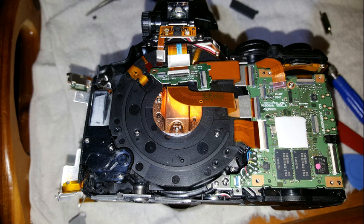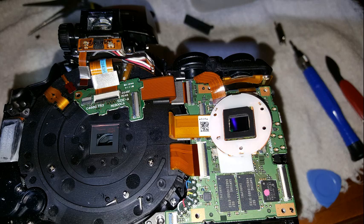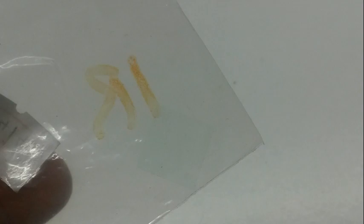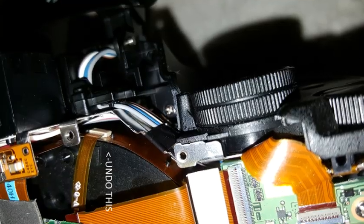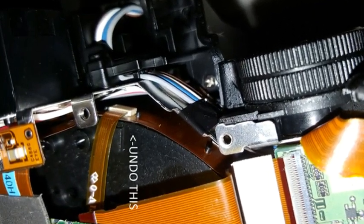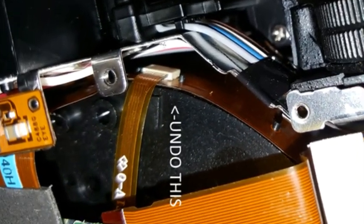If you want to work on the CCD you can now see the three screws holding it. I found using a straw as a suck tube was a good way to pick up the IR filter — it is almost invisible so be careful. I prefer to remove the lens without removing the CCD sensor. Before removing the three screws that hold the lens inside the lens barrel, you must remove the two FFC leads to the focus and shutter assemblies. The focus FFC is about three millimeters wide and goes up under the viewfinder mount. It is a push-in, pull-out type connector, so with a good pair of tweezers I was able to remove that FFC.